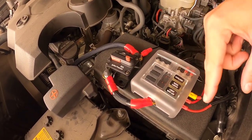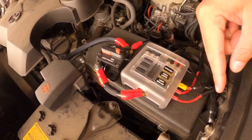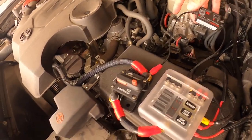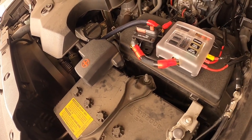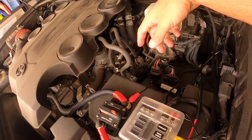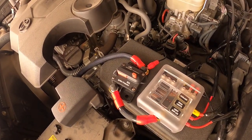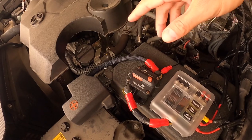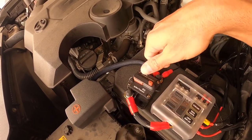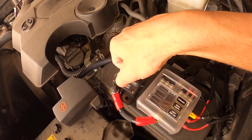My solar panel wire comes here — I have it labeled as auxiliary. I've got my rock lights and light bar hooked up, all those positives, and my big ground wire right here. I have a battery monitor right here keeping everything clean — it's Bluetooth so I can monitor my battery levels since the MPPT controller is not Bluetooth. Having the fuse block is nice because if I need to work on anything I can just flip this switch to cut off all power and flip it back to restore power.